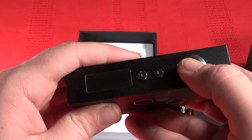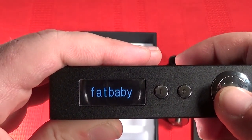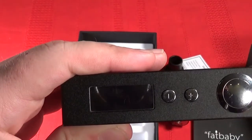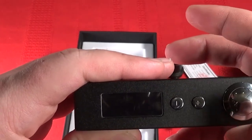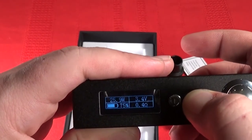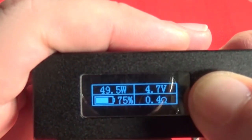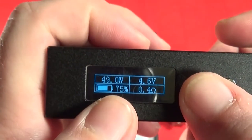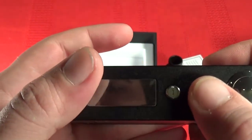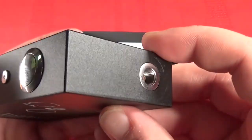Simple enough — five clicks on, five clicks off. Project Subohm modifies these chips, so it does show up and say fat baby on it. The other modification is it fires down lower — it fires down to 0.1 ohm instead of 0.2 or 0.15, depending on which version your Sigeli is. You can hold the up/down buttons and it'll go nice and quick. Once you get to 50 watts it changes by full watts, and when you get below 50 it changes in 0.1 increments. Battery life is killer — it reads in a percentage, which I really like. The display shows all four features, which is really cool.